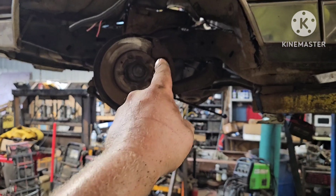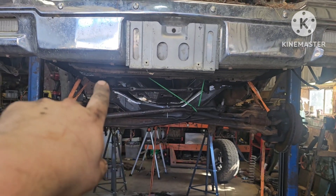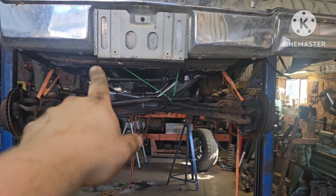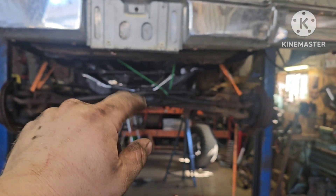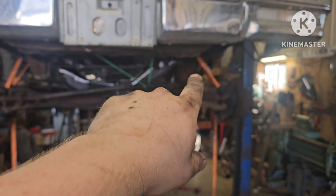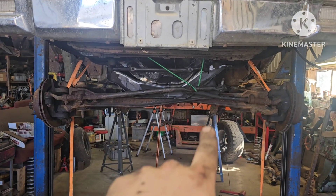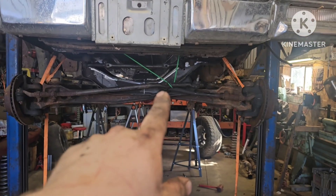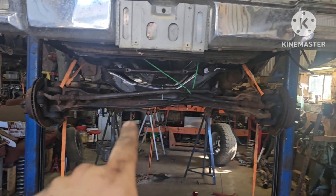Onto the front now — I'm going to be ripping this out and I've got something else to put back in. This is a twin I-beam front suspension out of a one-ton Ford van. I just cut the belly cross member out of the van — actually Andrew did at the junkyard — and then I notched out the belly cross member on the car and married the two together. I'll need to make some filler panels and do a bunch of welding. Then we gotta cut out the spring buckets and move some spring buckets out, build new spring buckets, and also build drop brackets for the pivot points. If I leave them where they're at, we're basically at stock ride height — that's no fun. So I need to make some three or four inch drop brackets front and back, then figure out the steering.